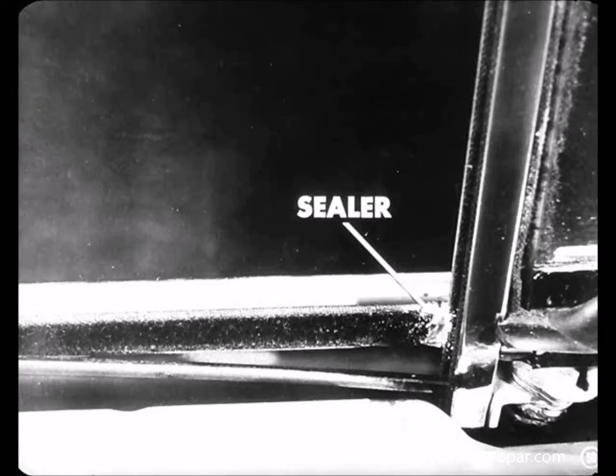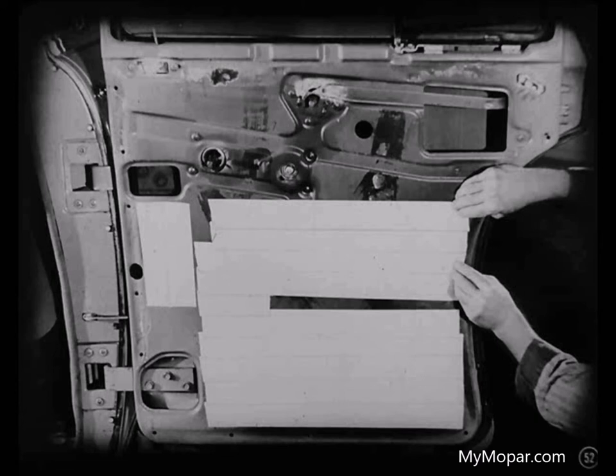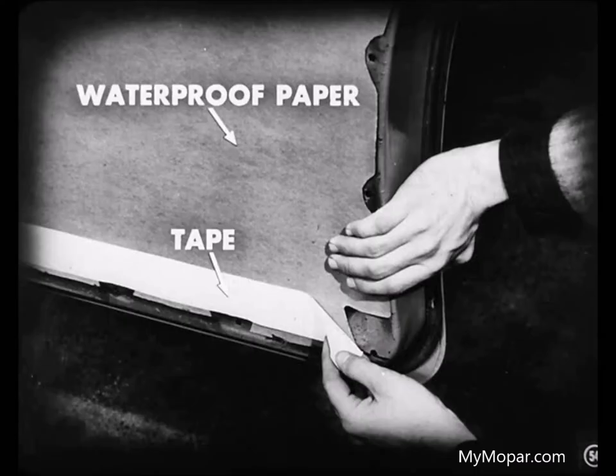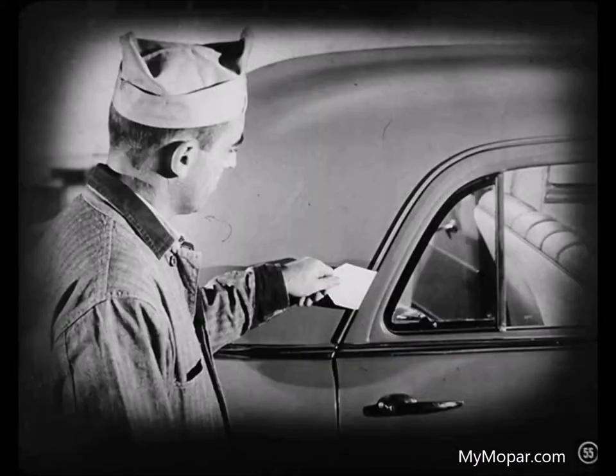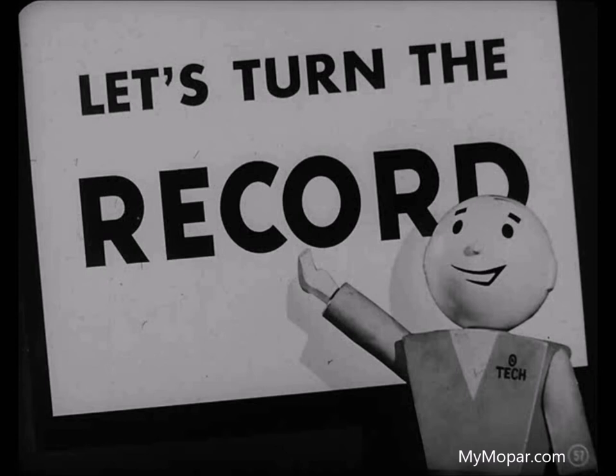First, I took off the trim and removed the door glass. Then I built a bead of rubber across the bottom of the door glass and put the glass back in. That bead formed a seal under the cat's whiskers when the glass was run all the way up. While you have the trim off, just look down through the door to make sure both ends of the cat's whiskers contact the side channels. If you see daylight through there, push a little sealer into the openings at each end of the cat's whiskers. Then water test the job. I'll bet you use the bottle test. Sure — you just pour about a pint of water down the glass. Almost all of it ran down the outside; just a very little got past the seal and into the door. Then I taped over the access openings in the inner panel using cloth-type adhesive tape, but first I drilled a quarter-inch hole in the angle at the bottom edge of each opening to keep water from damming up behind the tape. Then I replaced the waterproof paper and taped it at the bottom, and reinstalled the trim. Always check how the door weatherstrip seals — if necessary, you can move the hinges and striker in to make a tighter seal.